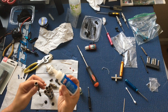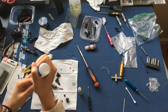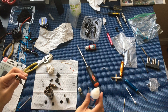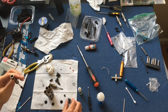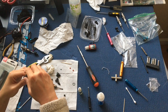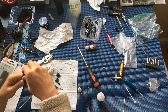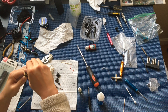Usually you want to fill up the shock about halfway, get any air bubbles out, and then go ahead and top it off. You may have noticed I was using a different bottle before — we had used that bottle to siphon out clean shock fluid because we wanted to put the RaceTech Ultra Slick Grease onto the o-rings first, so we had to drain out the clean fluid and then put it back in.